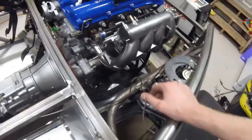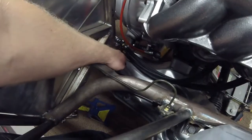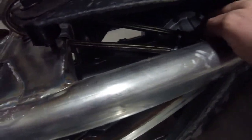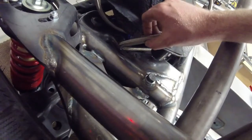I still have to put a hose between the rail and the fuel pressure regulator to complete that out. I haven't done that yet, but other than that the main parts of the line are run. I'll probably put another P-clip mount down in there somewhere when I pull this off, just to keep this line from chafing and being loose right here.